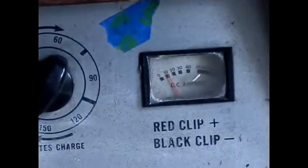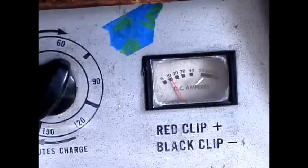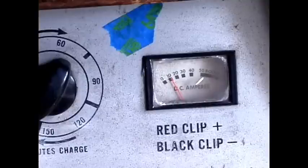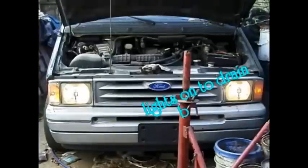The charger has started to get up to 10 amps. If it won't take a charge, use jumper cables to a good known battery, start the charger charging for 15 minutes, then disconnect and see if it will charge on its own. Some chargers won't charge a battery they can't see, and often they can't see a battery with less than 4 volts. Once it starts charging, lower the amperage setting and let it go for about eight hours and see what voltage it reaches and what the hydrometer reads for each cell.